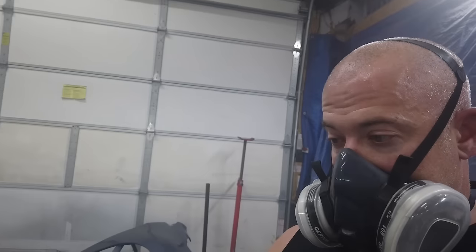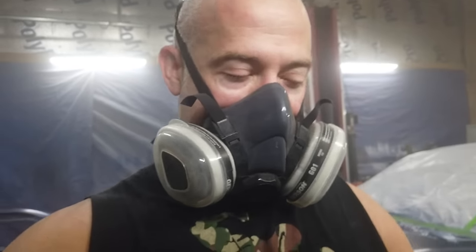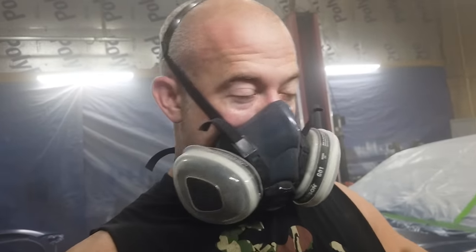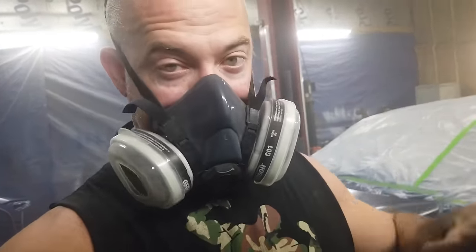So I got to really mess with my gun, figure that out before I run out of paint. When you have problems with your gun, search up what your problem is. Try to figure it out. Okay, so I got on the YouTubes and watched some actual professional painters, because I'm not one. And according to them, when you're spraying metallics, you want to do multiple thin coats. Well, I wanted to get good coverage, so the first one was thick. It's fine. So we're going to do two thin coats.